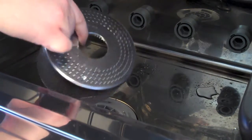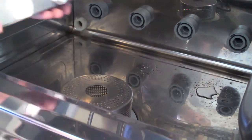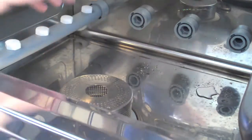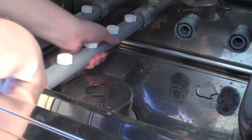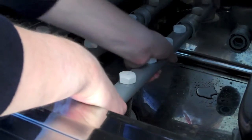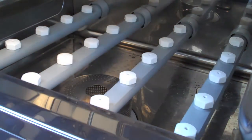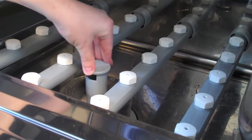So let's put your machine back together and get it ready for service. Start by placing the scrap screen into the center of the machine. Grab the first spray arm, line up the nipple, line up the two ends into the guide, insert and give it a quarter turn to lock it into place. Repeat this three more times — place it in, guide and lock. In seconds, your spray arms are locked back into place. Grab the overflow tube and press it into the center of the hole in the scrap screen — it should lock into place and you may feel a little click.